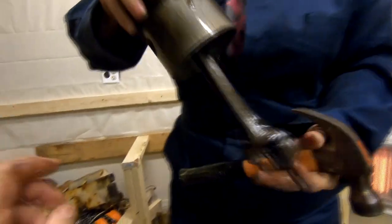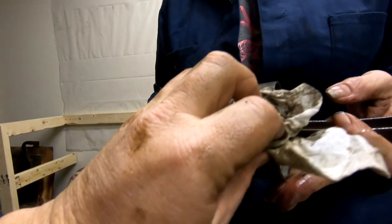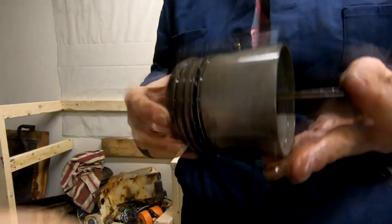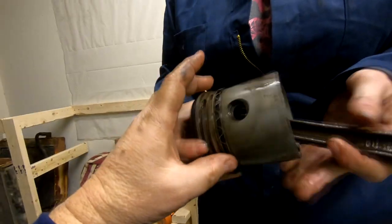I didn't know those were loose. Uh-huh, but take a look, bring it over here. Let's wipe this. I didn't know they were loose like that. Well, they're not loose once they're pressed inside the cylinder. They become really tight. But they're made springy, just to spring out like that, so that they'll press firmly against the inside walls of the cylinder.